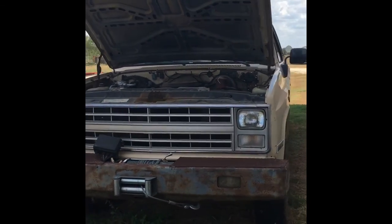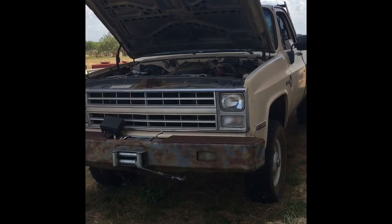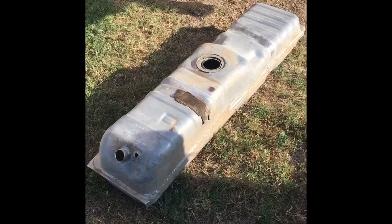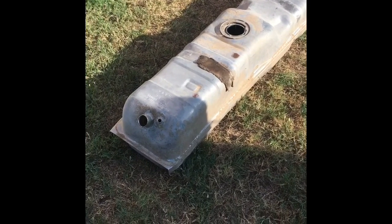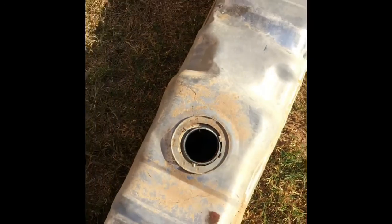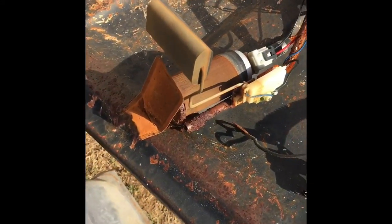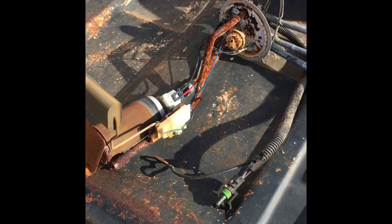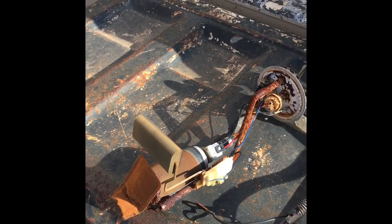Let's get started — I'm gonna drop one of the tanks and replace the fuel pump and see if we can get this one to run. Here's the fuel tank from the right-hand side of the truck. It's not in too bad a shape on the outside, but on the inside it was really dirty — rusted on the bottom and on the sides of the tank. I took out the fuel sending unit, and it's all rusted and corroded. The fuel pump doesn't work on it and it's just in really bad shape.